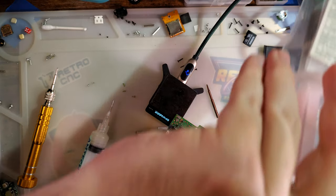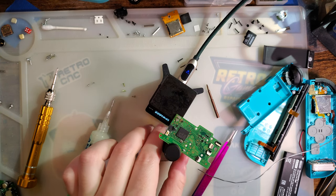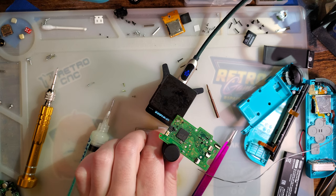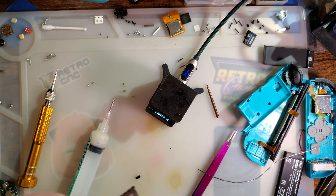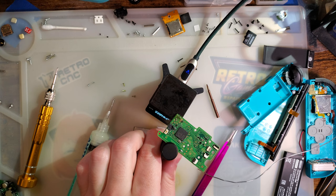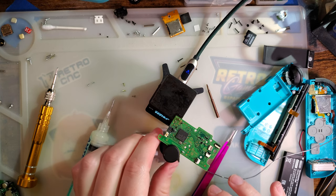Just put a little bit of solder paste on there. Ooh, the hot plate might be enough with this stuff. Just barely isn't. Oh, yeah, there it is. It's working. Excellent. Except for that one ground trace. That's unfortunate.